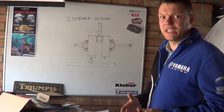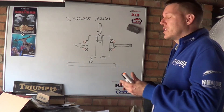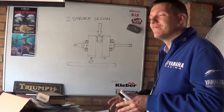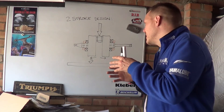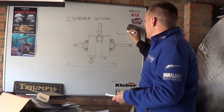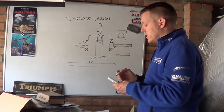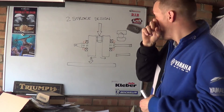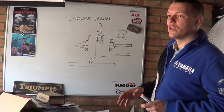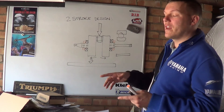So your crankshaft will literally start to rub on the inside of your cases, which is severely bad — it puts stresses and strains on your crankshaft, damages your cases, and can make a real mess of things. The sides of the bearings, even though they are not primarily thrust bearings, this is why we use ball bearings rather than rollers. Rollers can take more dynamic load for a smaller size, however rollers do not deal with thrusting — they only work radially.